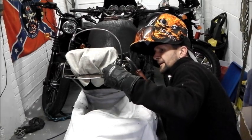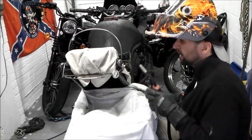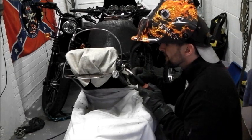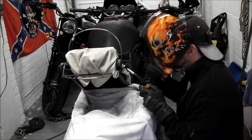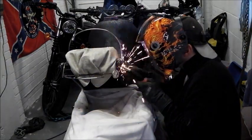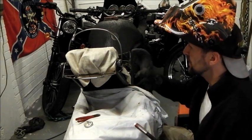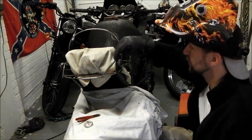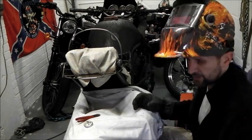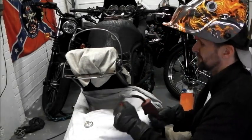Pretty vital that this particular part stays absolutely in the right place. It doesn't move. Kind of almost over welding these because I want them to be uber strong. That quarter rod effectively being bent round, curved so much, has work hardened and become quite tough, so it's not going to flex a lot.